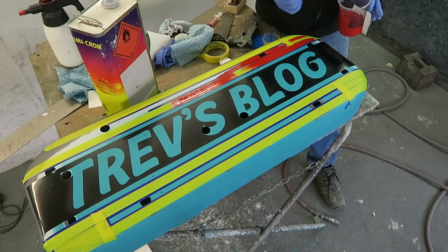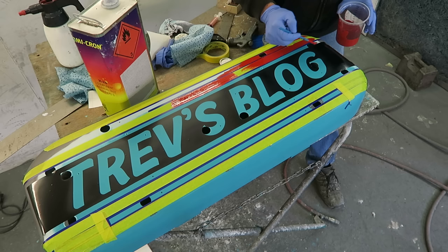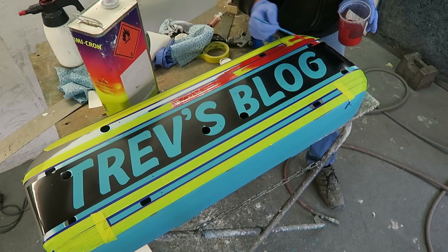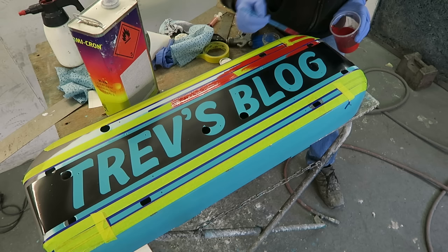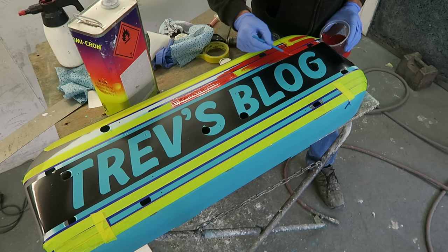You spray it on, it looks a little bit orange peely. You think, oh, I'll go a bit heavier now. You spray it on heavier, you walk away, and when you look at it five minutes later the whole lot's on the floor, so rather soul destroying. Far better off just letting it sit on the panel and flow out. It takes a little while to flow out. I hope this doesn't flow out too much, because we're going to lose the brush strokes.